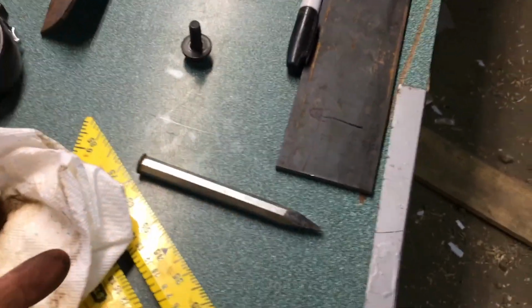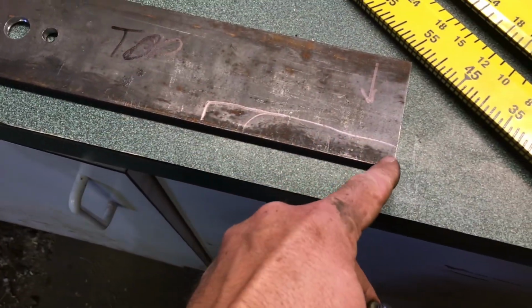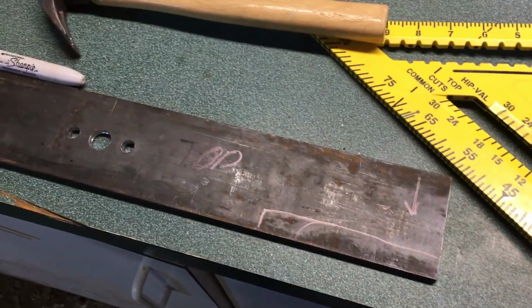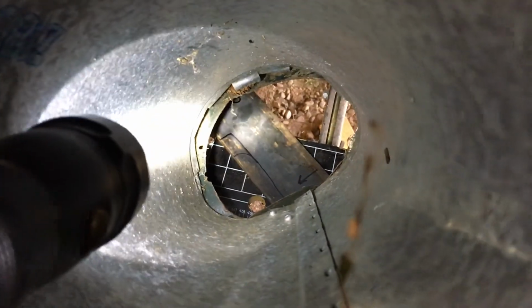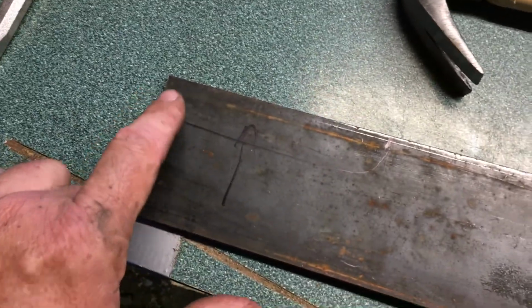And working on the blade, gotta go in and make a measurement of how deep I need to go in, aka how much of the hole this blade can see that needs to be sharp, so if a corn stalk or something comes in, it can hit it and get cut. So looking through the chute, which gets most of the action you see here, 5 inches is just about there, and you figure material is going to be entering as far as up here, so we probably need to go to 6 inches in. 45 degree angle, we'll do that. 45 degree angle should be great for this.